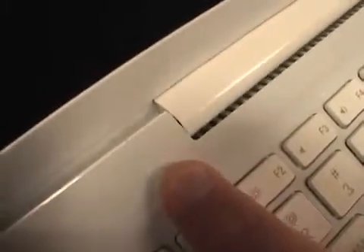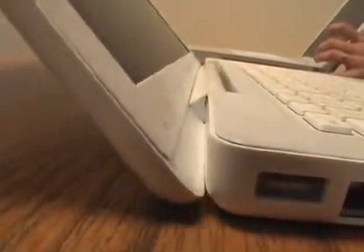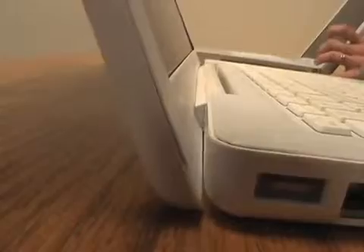Now, check for scratches and damage on the white part of the computer. No major scratches, dents, or dings on the corners, edges, or cracks — any scratches or dents that do not impede function of the machine are acceptable. Check to make sure the hinge functions properly and the display frame is not pulling away from the display or cracking. Make sure the display is in alignment with the bottom keyboard area when the laptop is closed, and that there are no screws missing from the bottom or side of the case.